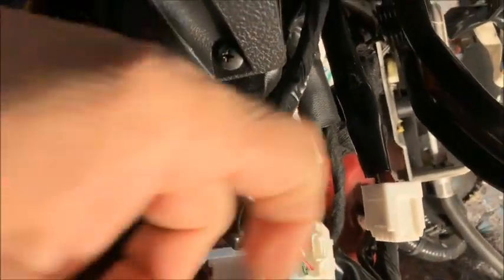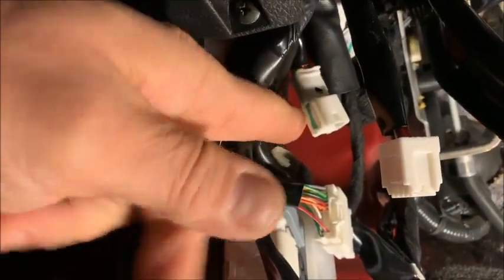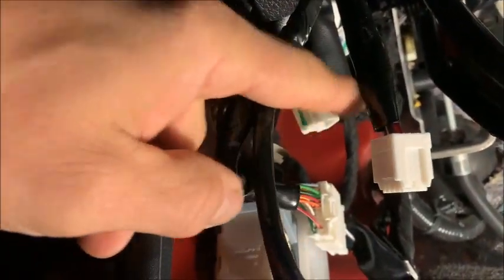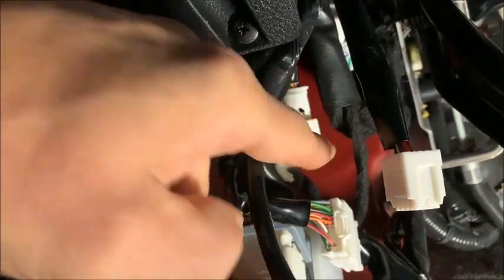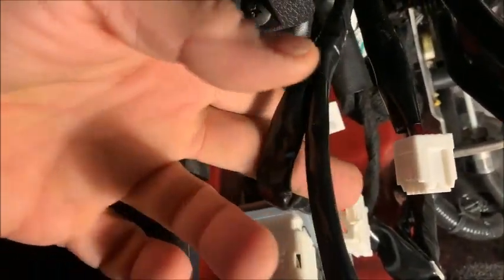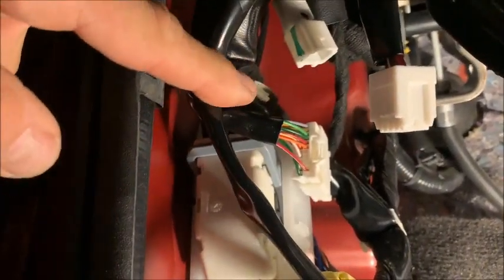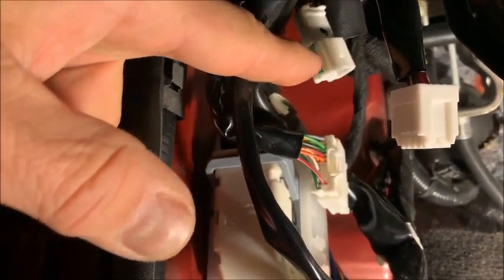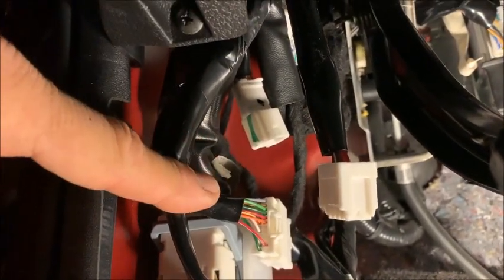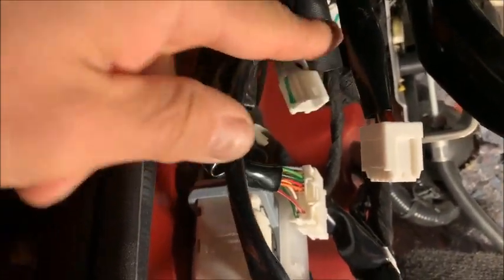If I can get a shot of it, not sure. But this connector back here is your accessory connector. As you can see, it's taped up underneath. It was taped all the way back. You actually have to look for it carefully. It's got 12 wires on it, and the color code matches what the book says. Obviously, it's really hard to get to this cable to wire it, and I don't want to really wire directly to the car. Therefore, I bought the accessory service connectors, which are the male counterpart of, I'm sorry, let's see, male or female?